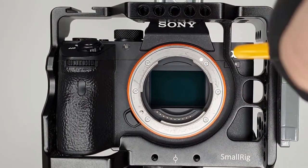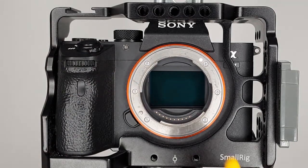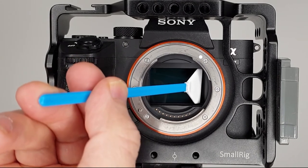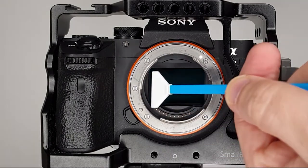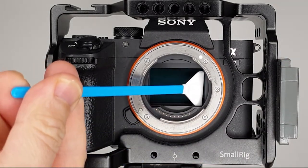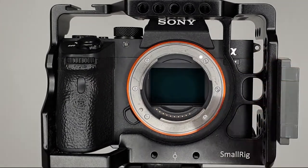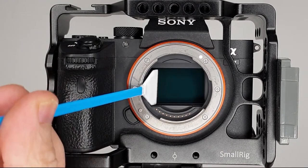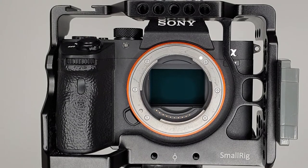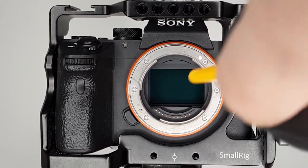Use the blower first to get rid of all the loose dust. Remember, the camera is upside down so the sensor is pointing to the floor. Then with the wet swab, run it over the sensor — you don't pass it 100% over the entirety, go about 90% in one direction, then stop. Change direction and continue that way so you're not brushing everything into the corners. Just be wary not to over-do the swabbing. Then use the blower again to dry it so no residue is left on your sensor.